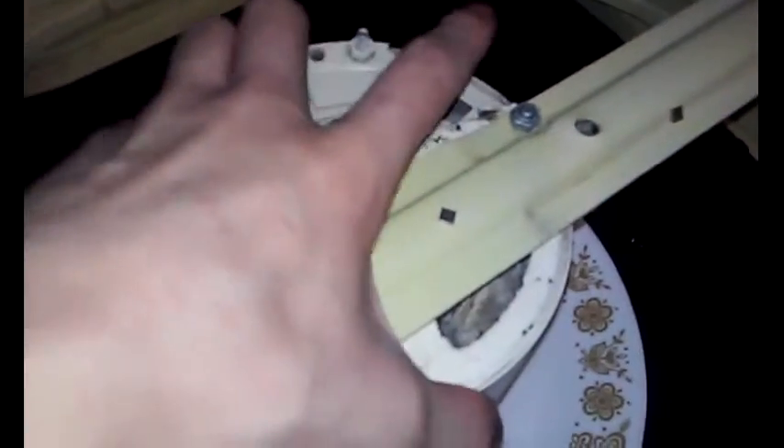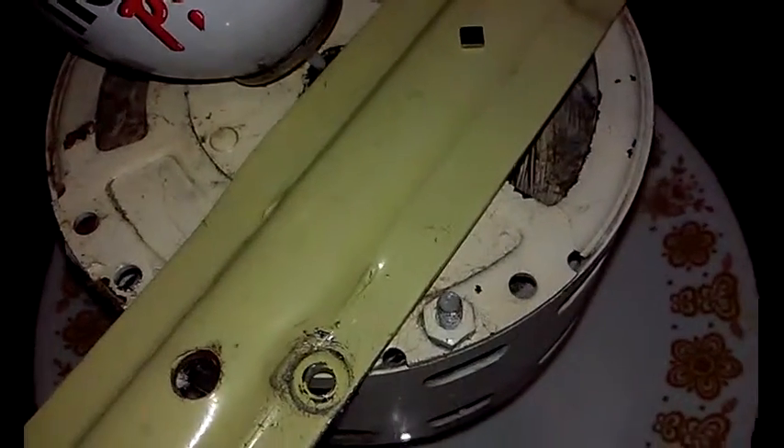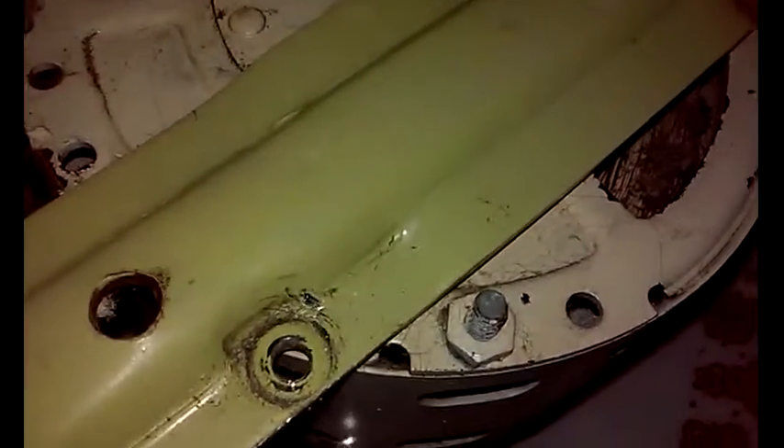You can spin it a little bit without messing up the wires. Right here in the back you can see there is a lot of dust in there, and you can see there are ball bearings. I'm going to use Liquid Wrench — this is oil, it will stay there and will not evaporate for a while. Just put some in there. I put a plate underneath in case it drips, because you're going to keep putting it in there. This fan probably has never been oiled before.